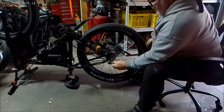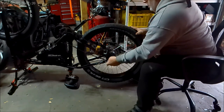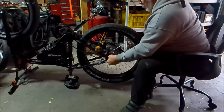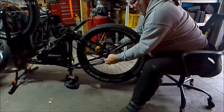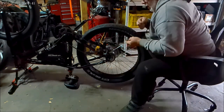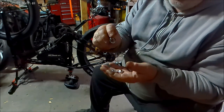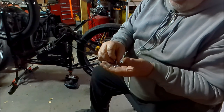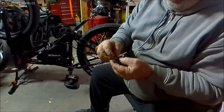So how do I know that? Well, I learned the hard way - I snapped one of the axles by tightening it up too much. When you do it this way with this clamp, you can unscrew these by hand just by loosening them up, and then the little washers just slide right off. These little washers are square shaped and hold the axle - it's basically almost like a torque arm, it keeps the axle from spinning.